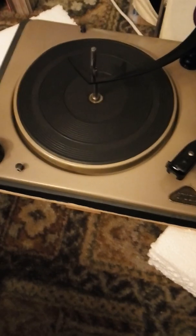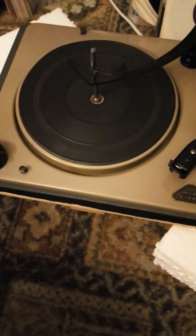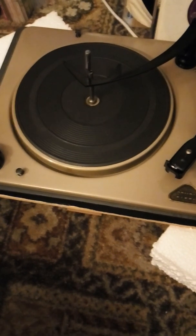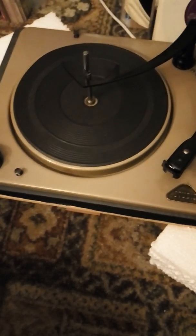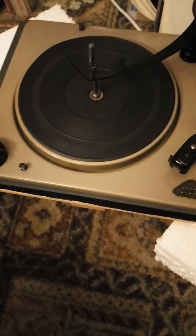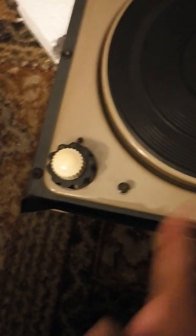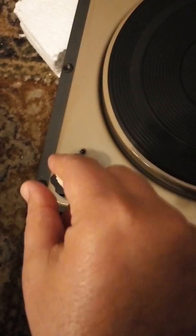What happened on this one as well: there's a rubber idler wheel in there, and the rubber was actually hard as a rock — I've never seen rubber go so hard in my life. I looked around the internet and found some guy selling them, so I bought a whole load. I've got a brand spanking new rubber idler on this, and it's going around lovely. That's not the original knob by the way, that cream knob — I've got another two of these.